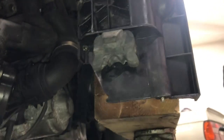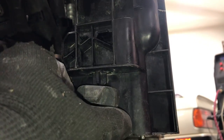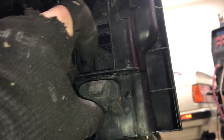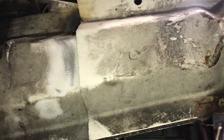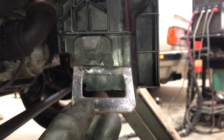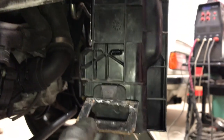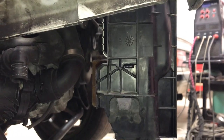This is the passenger side. You can see that this rubber mount here kind of slips into this little T-shaped thing. Then we have our frame rail here, which does need to be strengthened, but we need to connect A to B. This is going to help us do that. We're going to end up bending it, folding it, welding it, and then we're going to make another bracket that connects that guy to that guy.